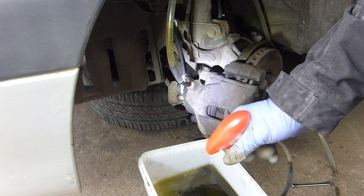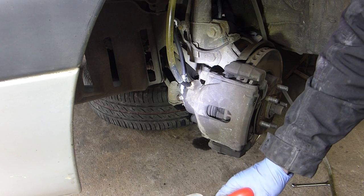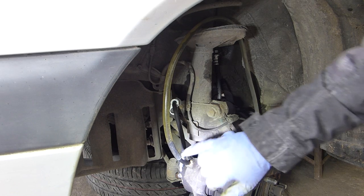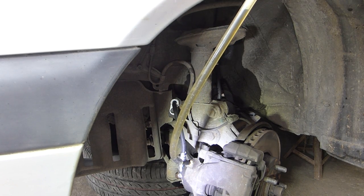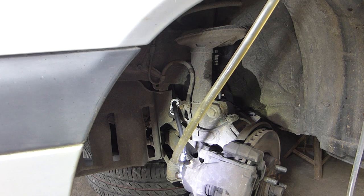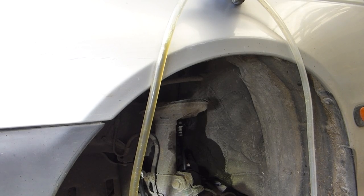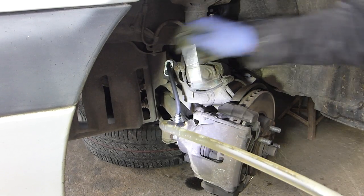That's just oil that was already in the brake fluid in the tube from earlier when I did the other three wheels. But look at all the bubbles going up — that's it, we've just bled the brakes. Because I have a poor connection on the tubing it will continue to pull bubbles, but look — we're after pulling this amount of oil vertically up a tube, and the only way we did that was by making a vacuum and pulling that oil out of the line. If I pump this thing again it goes higher — eventually there isn't that much oil in the line. We've pulled it higher than the wheel arch, and I could pull it up the bonnet as well. I bet you any money that's bled.